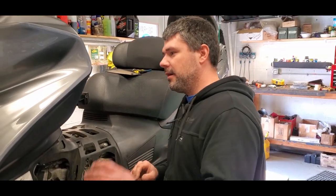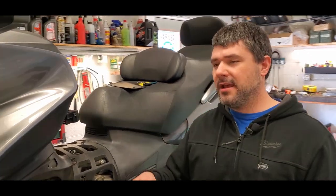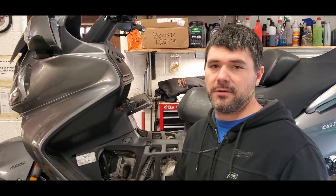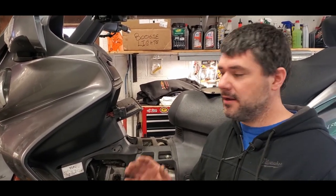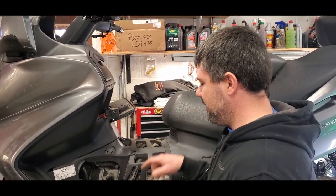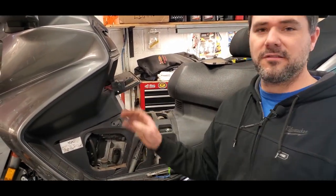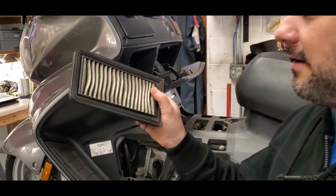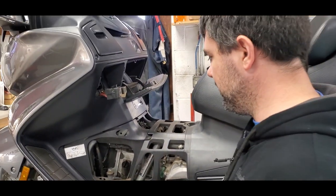That works too. One of the things that we found over the years with getting these bikes ready is we used to go off of service recommendations, like when something should be serviced. That's when we thought it deemed it necessary to check stuff. What we've been finding is that with things like air filters, you don't really want to go by the checklist. On the Burgman here, it's super easy to get to the air filter, so why not check it? And this one here, I'm glad I did, because this thing is nasty. Definitely getting a brand new air filter for this one.